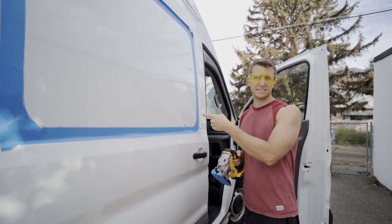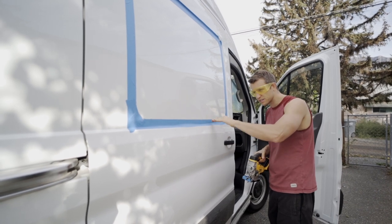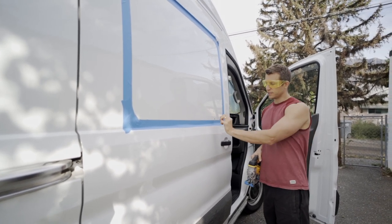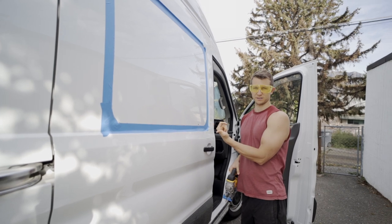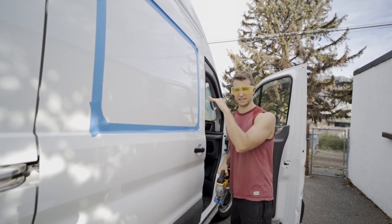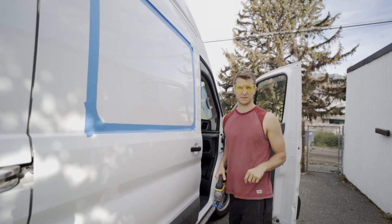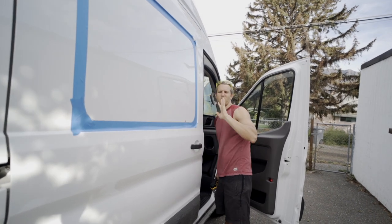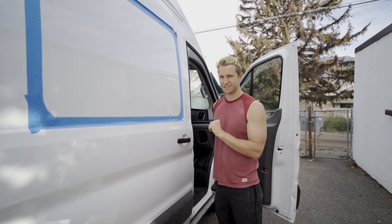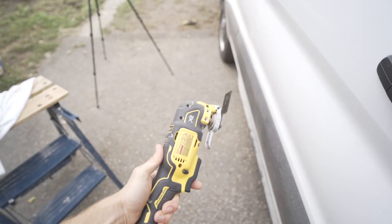While we're doing this, Katie goes on the inside of the van. As we said, there are two layers and we ideally just want to cut the outside layer and be really close to the inside layer. If you leave too much of a gap when you put your window trim on, you'll still see the metal of the outside layer and it won't look clean — try to get as close to the inside one as you can. It's okay if you cut it, you just have to sand, file, and prime it. And do not forget where the lock is — it's a tricky spot right on the corner, so we're going to use the multi-tool there.